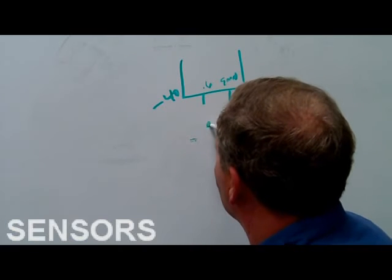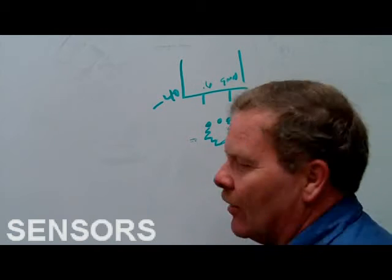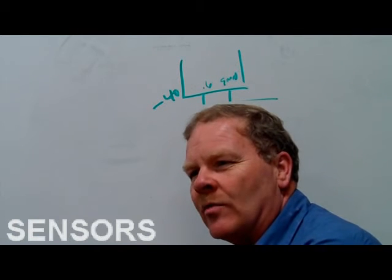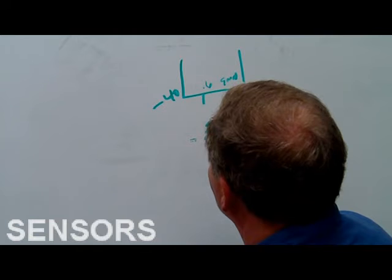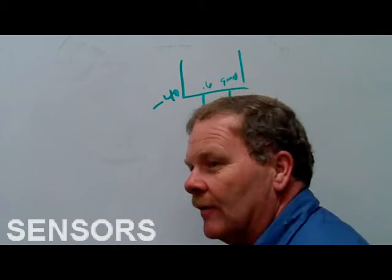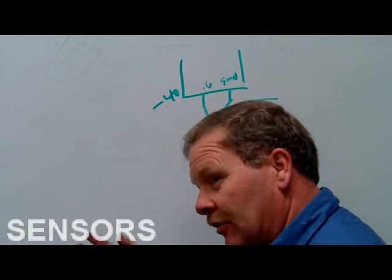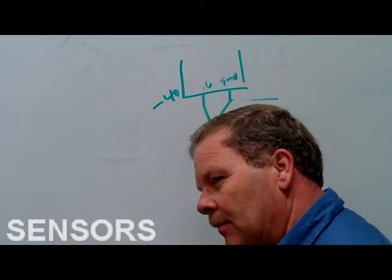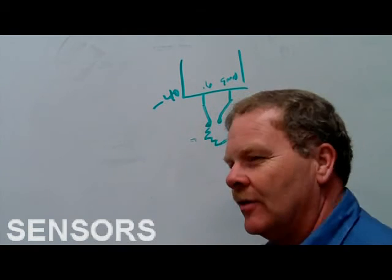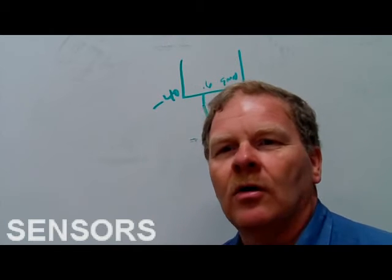In other words, I put me a potentiometer in here. This is one of the things I bought from Radio Shack, and I would make sure it was like a 0 to 50,000 ohm or something like that. And then I would take this right here and hook it there, and then hook it right there. Don't even hook up the third one. And I could watch that voltage with my meter or the scan tool even, while I turn that knob, and I could dial that thing down to the place where the fan was supposed to come on. Even if the engine would be bone cold.